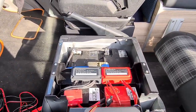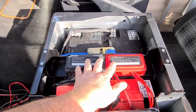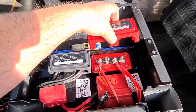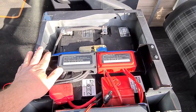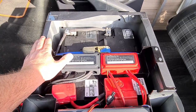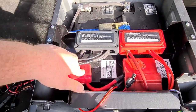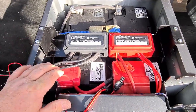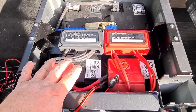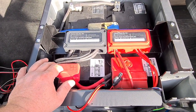Before I install the inverter, let's recap on what we have. I have two 120 AGM batteries — just installed, brand new — with heavy duty bus bars. When I installed the swivel base I didn't realize how big the gap was underneath the seat. One of the issues I had was the exposed live terminals. So I found these caps from scrap yards and other places. That gave me reassurance that I wouldn't drop anything on top of the battery terminals and cause a short or damage to my batteries.